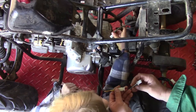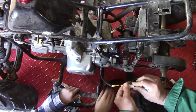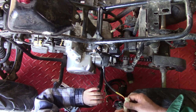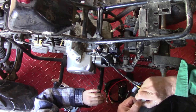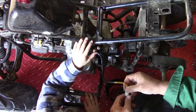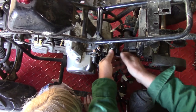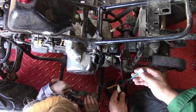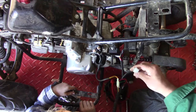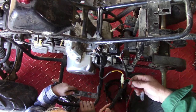That's the brake — it goes to the brake light. That definitely has the green and black wire. These wires match — see the green and the yellow? Why are they using all the same plugs? Could have bought a different kind of plug. This one goes up here into that box. This goes to these wires that we already spliced in. We don't need this plug because this is essentially the same plug. If we'd bought this first, we could have just hooked these in directly instead of having to splice them.